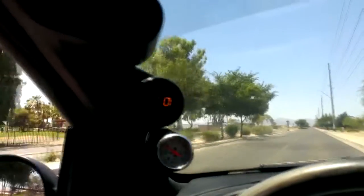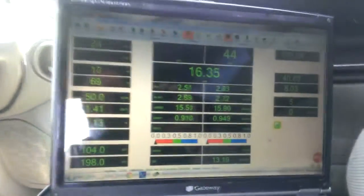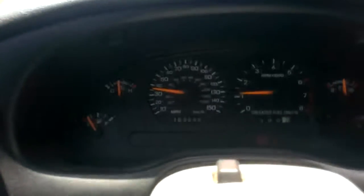I'll have to look at the log later. The data log can do a lot better than you can looking at it with your naked eye. Going to fifth gear here. You can see it's hunting just a little bit, but it'll dial in. Didn't even clear the computer. I got F1 and F2 at about 0.9 still. Going to get the cooling system flushed on this - this thing has been running rather warm. I don't think it has a thermostat, or it's stuck open.